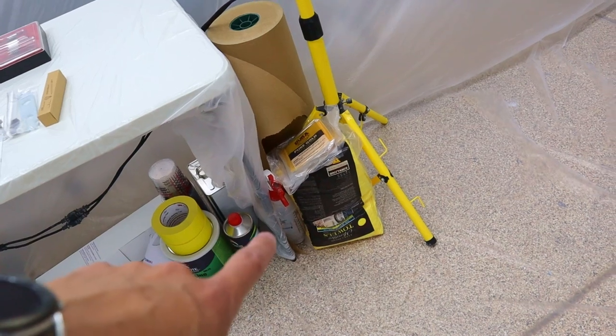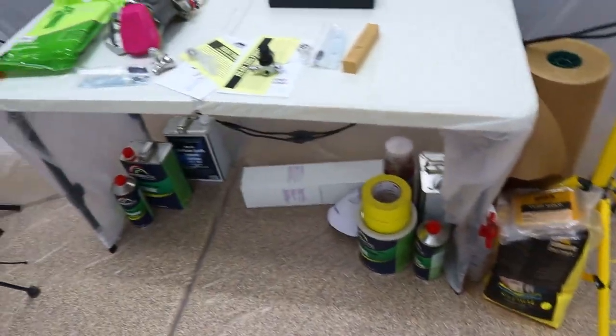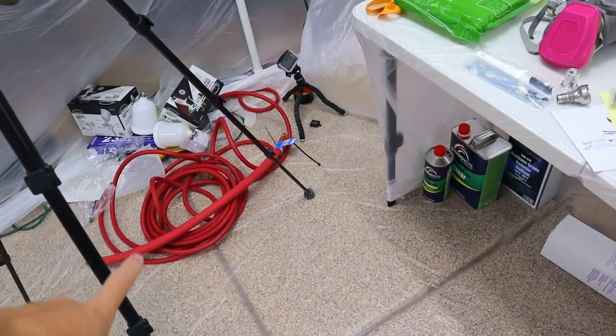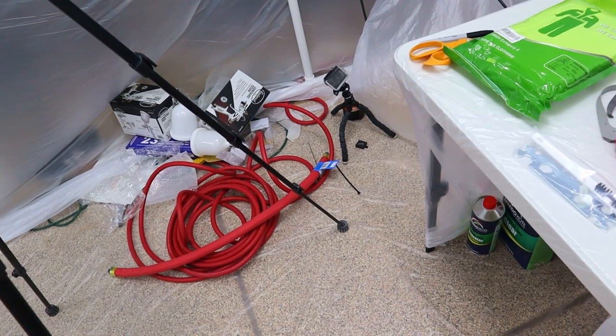I've also got some microfiber towels and some tack cloths. So I believe we are set. We'll get things set up. Got to get some air hose connections and things. Oh, I also got a desiccant snake. But we are close. So I'm in the paint booth. I'm going to start cleaning some parts, gowning up, and doing my first coat of primer. Wish me luck. The temperature in the garage is 75 degrees, and we're at 27% humidity.